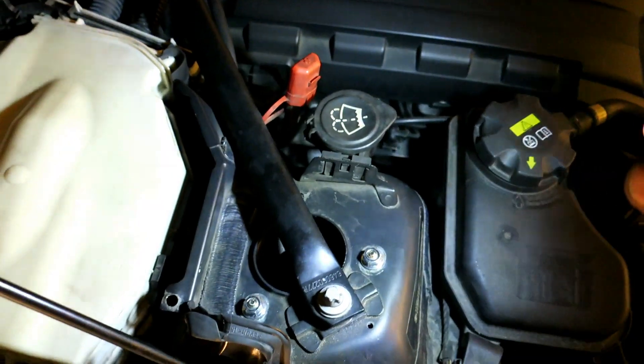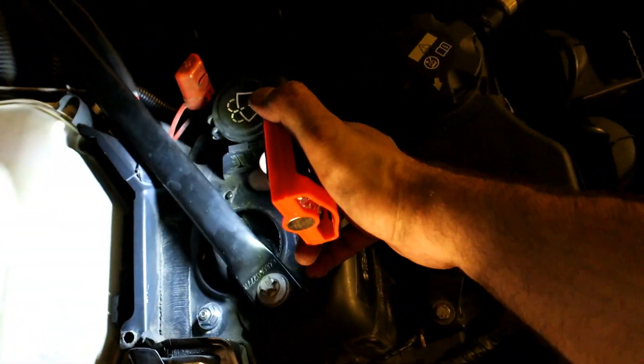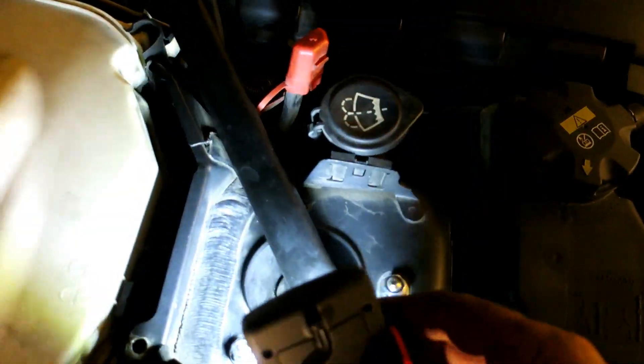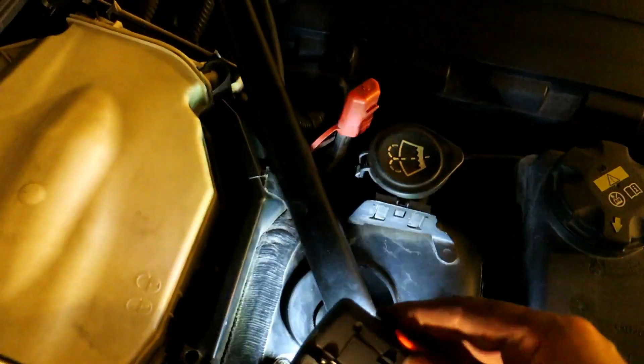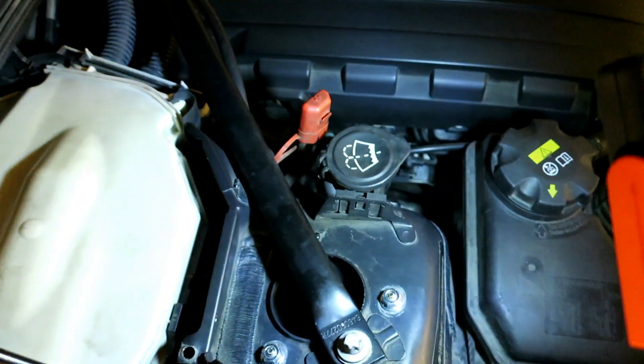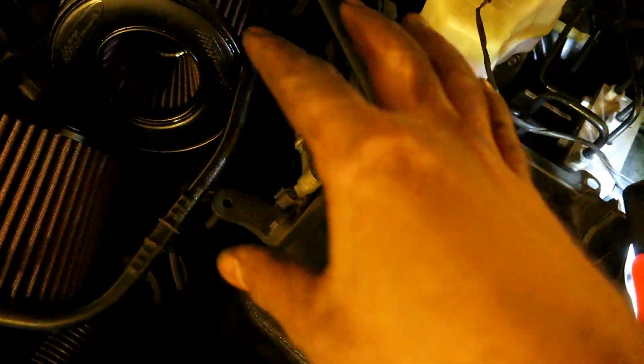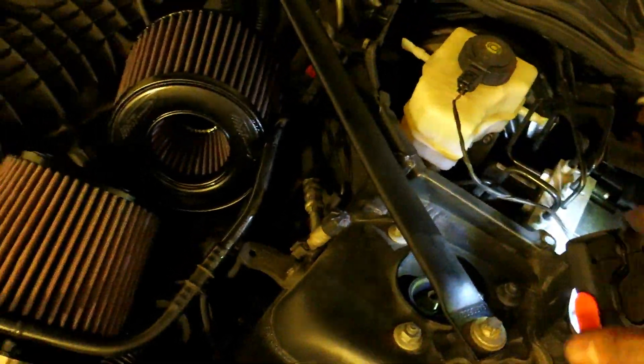Get the car on level ground before you let the body settle to a natural position, then tighten down the bolts. The guide pin kind of forces the correct alignment - when you lower it to ground level it lines itself right up and then you just give these a final torque. This was definitely installer error on my part. When I lowered the subframe to change the oil pan gasket I wasn't conscious of the orientation. With this new mount you can feel that inner lip is perfectly aligned inside the bore.